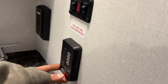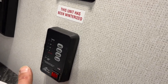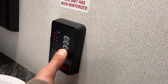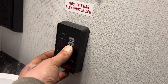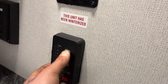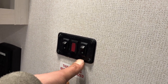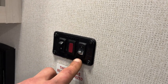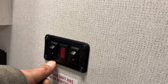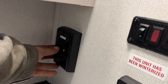Hot and cold water at the sink — the panel underneath is just a close-off panel, not storage. The monitor panel shows your water pump switch in the bottom corner — turn it on to pressurize your lines from the fresh tank. Battery status shows C for charging, G for good, F for fair, L for low. Your fresh tank indicator goes from a third to two-thirds to full. Same idea for your black and gray tanks. Hot water tank controls are up top — the flame symbol on the bottom right is for propane. If the red light comes on, it hasn't fired up; turn it off and back on to reset. The thunderbolt symbol fires it up on electricity. The GFCI outlet has a test on the left and reset in the center — if you ever have outlets that don't work, that's the first thing to check.